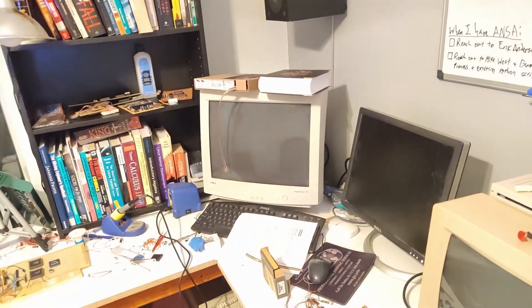So I'll get more into the video hardware here — I'll pull it out, I'll show you what it looks like. That's gonna be a fun process because, firstly, there's a monitor that goes with it that I do not have. They're pretty hard to get, they're crazy heavy, and they've probably mostly been scrapped at this point. But I see online that any decent multi-sync monitor should be able to do that. I should see if I can try and get that guy to work, because it's just RGB signals coming out of the thing and then I think it's sync on green. So hopefully that guy can do the job and I just have to make a connector. There's like a 20-pin header in there that has the video signals. And then on top of that I shoved this thing in — because I was like, oh, maybe it'll boot up and VMS when it starts up — I have the DECwindows stuff installed, so it tells you when it starts up. Usually every time I start it up it has a specific line that says, 'No graphics hardware detected.'